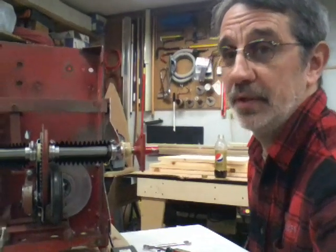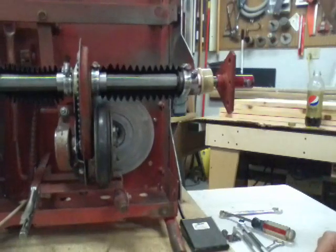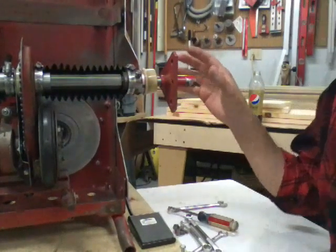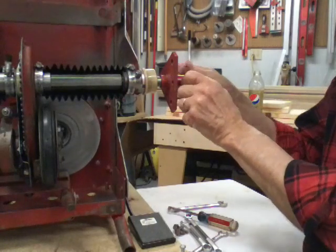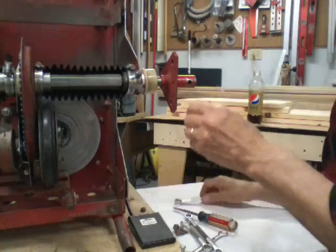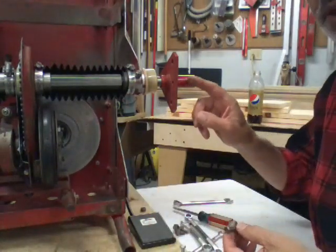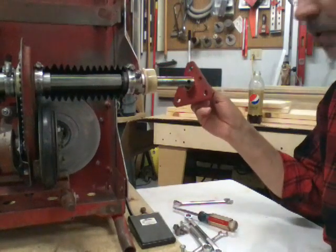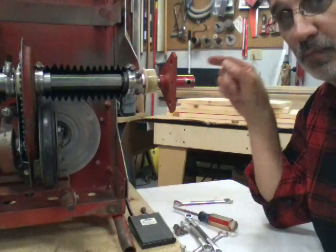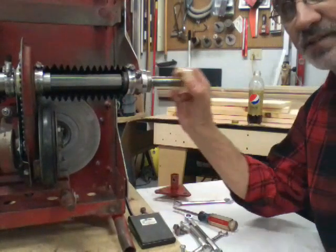I want to get this down a little bit lower. First thing you want to do is take your tire off — I don't have the tires on. Next thing, take this nut off of this bolt. You're gonna have to tap it — I use a nylon hammer so I don't hurt the threads. These bolts have a tapered head and they get wedged in there pretty good. Then your wheel hub will come off. If yours is rusted on and stuck, one of the upcoming videos will show you how to get it off so you can reuse it.